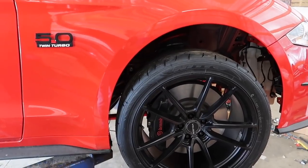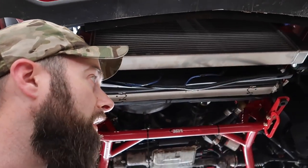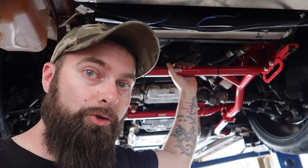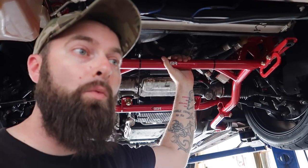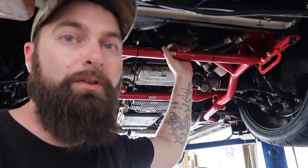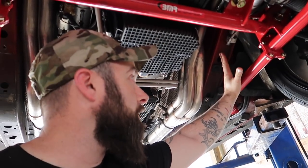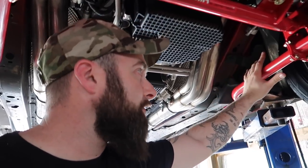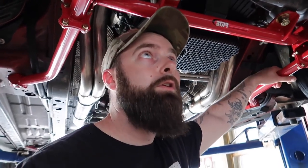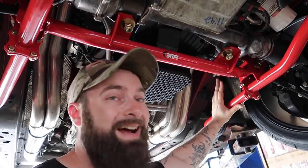Let's get the car in the air and show you what's underneath — there's a lot to show. We've got our triple pass heat exchanger — really nice. This is the new BMR K-member. In the past we had the drag version; this is their new street version. I decided to pick this up because I wanted a little bit more comfortable ride as far as steering wheel feel. This has a little bit more structure, and these leg kickbacks are removable — so if you have big twin turbos hanging under here you can remove them. There should be more rigidity — this is more of a street style, maybe road course worthy K-member. It's a little bit heavier than the drag version.